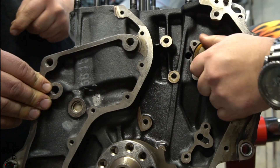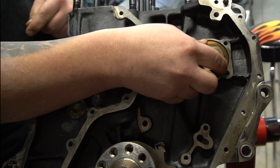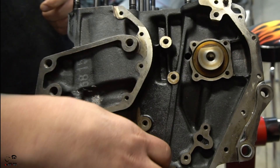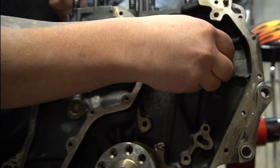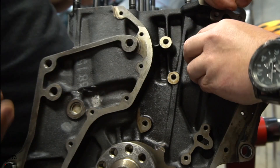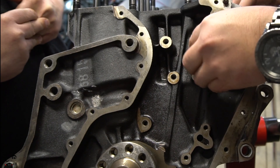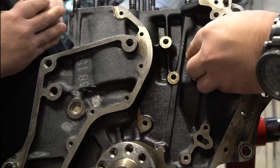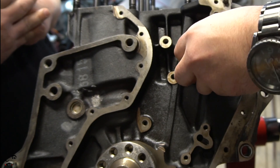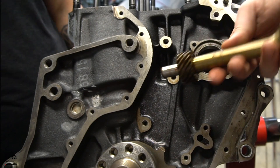That's in pretty good. It would be cool to have a mini press but we lined it up and got it. Success — there's your intermediate shaft and that's what drives it. No play at all. Just to show you — the worn one had a tenth of play. When you're revving this thing to 8,500 RPM and this thing is spinning at roughly half that speed, that excessive play is what was causing the knocking on the motor. The intermediate shaft bearing is now complete.